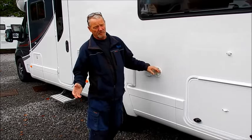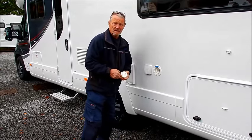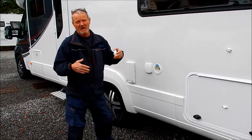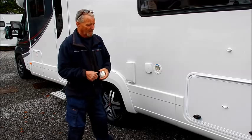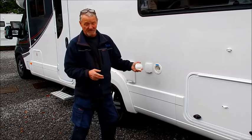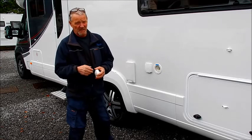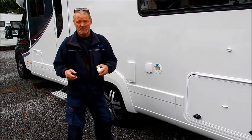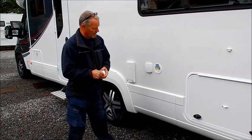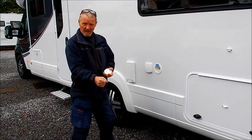It's the fresh water intake. If you have your vehicle parked on your drive at home and you're going to take water on board, it's a hose pipe in — fill it until it overflows, or carry as much water as you want. Most people tend to just carry enough water until they get to their destination, then fill up on the campsite rather than driving with a full 100-litre tank — you're carrying an extra 100 kilograms of weight. So just a couple of gallons until you get there. You'll need some hose pipe and various connections — usually hose lock fittings, available from most DIY shops.